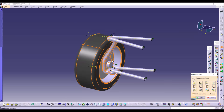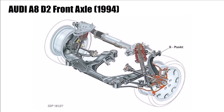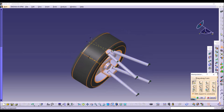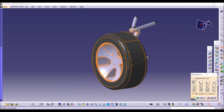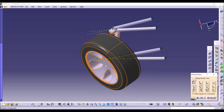Another big advantage was that the damper was now completely isolated from acceleration or braking forces. So the damper rod could be a lot thinner, internal resistance was lower, and there was more room for the damper piston and its valves, which resulted in a lot more comfort. Another side effect was that the wheel needs a lot less space while turning, which means the wheel arch can be smaller and hence there is more space in the interior. But also camber, caster, and all other settings could now be changed in every situation — and that's what made this front axle so complex.